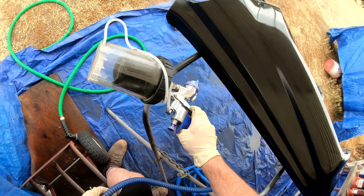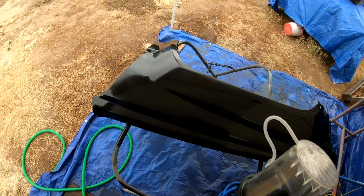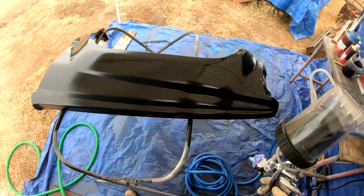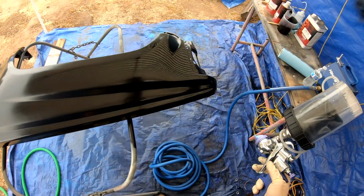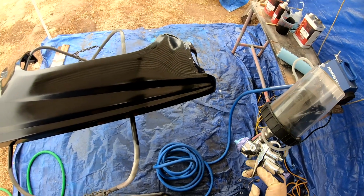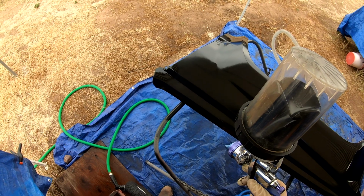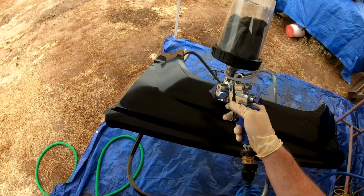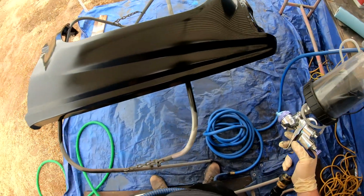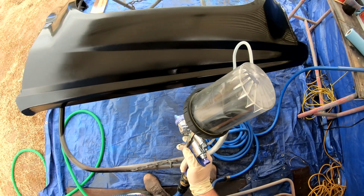And I came back the next day and I started wet sanding it. I actually thought I'd go a little faster than I did. I thought I could get it all done in an hour, but when you start going through it and you're fine tuning it, you're seeing every single flaw. So it ended up being like 2 straight hours of wet sanding to work out every little flaw, every scratch. And you might see me load up a couple of different spots here with more primer, because those are the spots on the fender that had the issues.